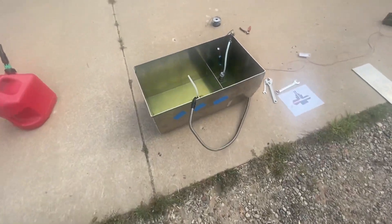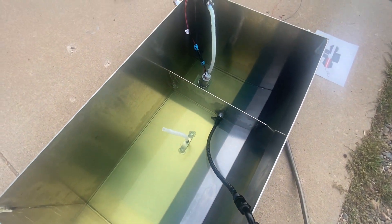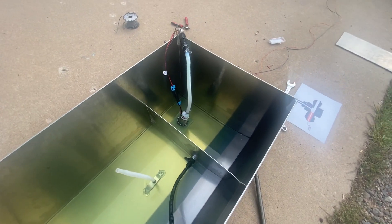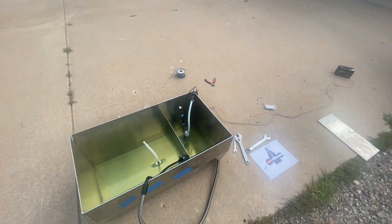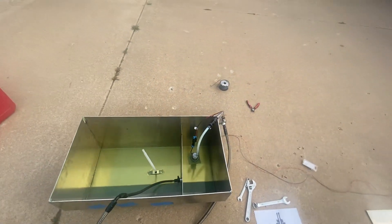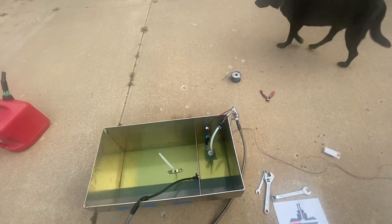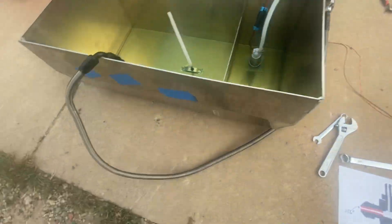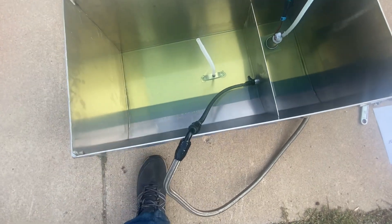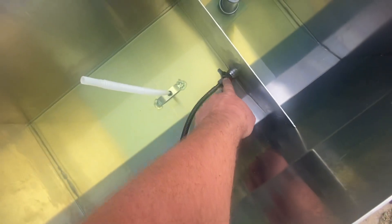The new tank I built has a divider wall, and the pump will be in the back portion. We need to pump fuel from the front portion into the back portion. We have the fuel pump return going into the back portion, but we also need to suck fuel from the front into the back to keep that full. We've got a Walbro 450 going through a regulator, then your fuel rail and fuel filter, and then the return coming into the Venturi jet pump.